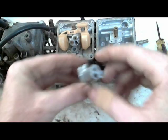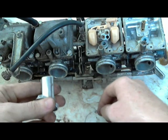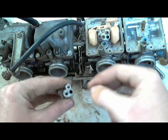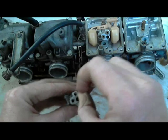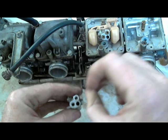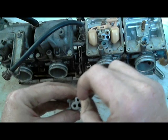Right now I'm going to go through this with my guitar string, wherever it is. Okay, there it is. So carburetor cleaner is close by there. So all I'm doing is spraying a little bit. I'm not even spraying full blast. I'm just getting a little bit of carburetor cleaner in there just so that I can poke the needle through. It's a tiny hole. This first one that I'm sticking it through on the top is the one where it's got a little jet inside of it that I can't get out. There's not a screw head on it. I actually don't know how they put it in there. It might be pressed in or something.